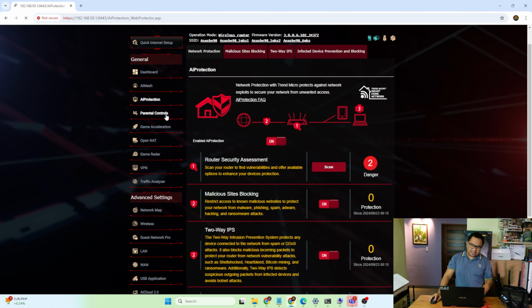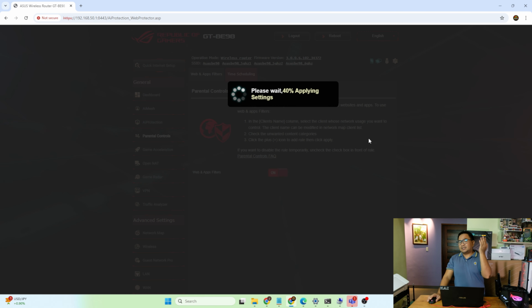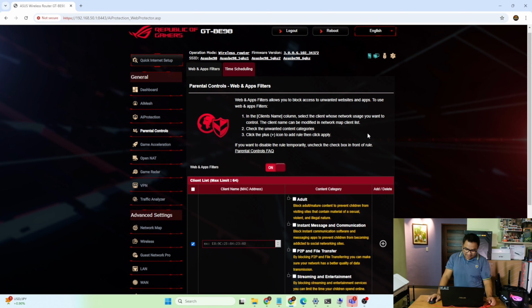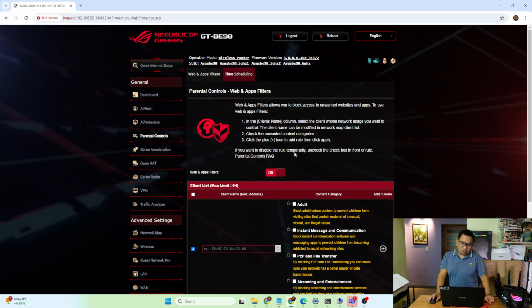Okay, next one would be parental controls. Guys, for the parental controls, we have created a dedicated video for this one. You can check that one out on what it actually does. Okay, we have turned it on as well. And for just a brief background regarding this one, you have here the web and app filters. You can filter it for specific devices, like for example, adult content, instant messaging. You just drop down here and enter the MAC address and it will take effect on those devices. And of course, we have your time scheduling as well.